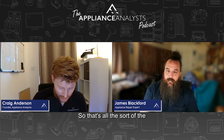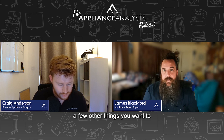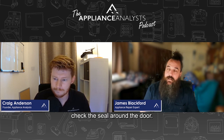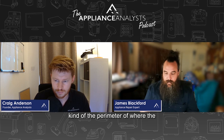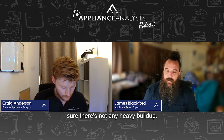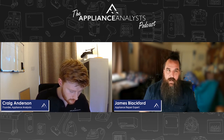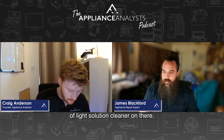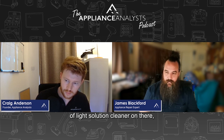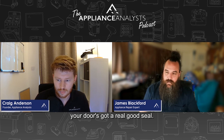Nice one. So that's all the regular maintenance to think about when it comes to a dishwasher. There are a few other things. You want to check the seal around the door, which is that black seal that goes around the perimeter of where the door shuts, and make sure there's not any heavy buildup. You could take a warm, wet rag, maybe with some vinegar or some kind of light cleaning solution, and run it around the seal, so it's nice and clean and your door has a really good seal.